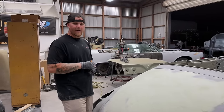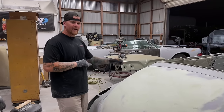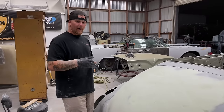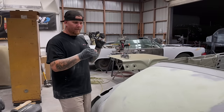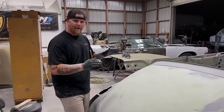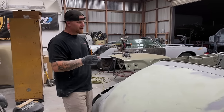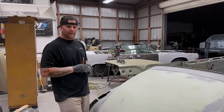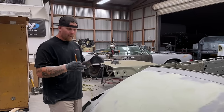This is how you dial in roughing in a car. I know this is a video and you guys think this is edited, but with putting it on and sanding it, no more than 20 minutes and I'm 80% done with the trunk of this car. I only sanded this thing for 10 minutes. It only took us a total of 5 minutes per spread to put it on. Then we spent more time waiting for it to set up than we did actually working it. You should be thinking about all of these things to work smarter, not harder. The whole goal is at the very end you're using that last little bit of primer to feather out the finer grits. At that point you're not removing a dent, you're removing scratches.